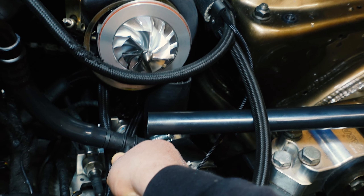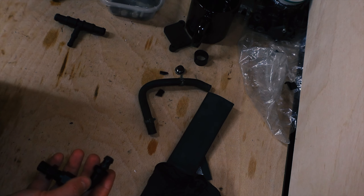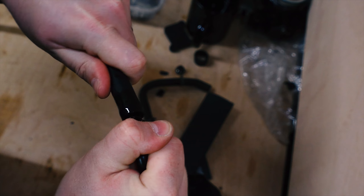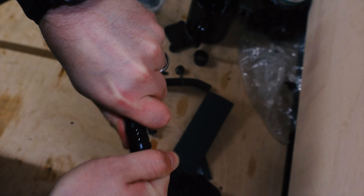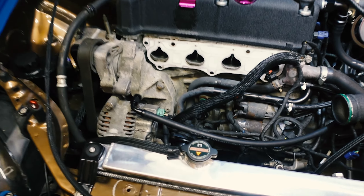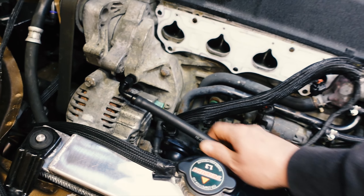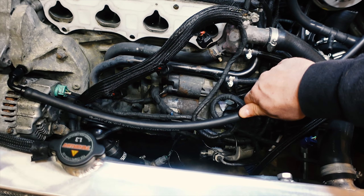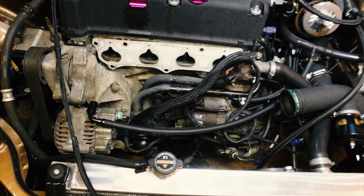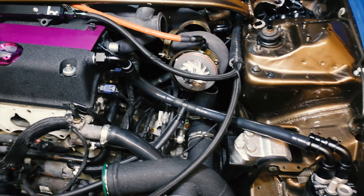You can see here that you don't want the hose to kink coming off the rocker cover, so we're going to take a fair bit out of that — probably 25mm, about an inch — and just let it run slightly lower back to the catch can. Going back to our push-fit barb fitting, it should be nice and warm now after about 10 minutes. Straight in until it's sitting nice and flush. In terms of routing the hose, you don't want to run it completely straight because you don't want any oil having the chance to run back into the crankcase, so I'm going to run this with a slight bow in it.